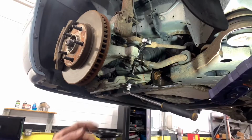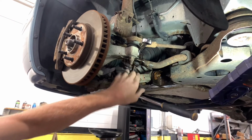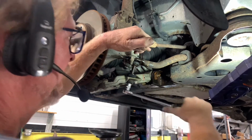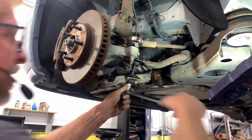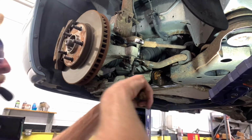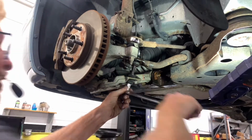I've started into it, and I'm going to walk you through it. Alright, so you've got a sway bar link coming across. This thing's rusty, so you have to take it out. Most likely it's not going to come completely out. We're going to have to buy a sway bar link for this side. It's a 14 and a 14 on the top, using the gear wrench and socket here.